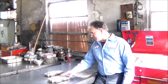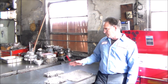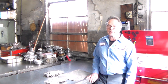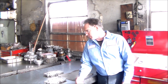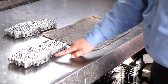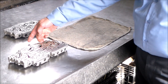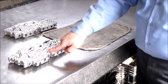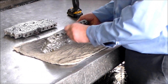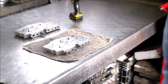I'll get a little closer and we're going to take this one apart, lay everything out, and then put it back into the new casting and install the lower front half onto the valve body. These are T27s, so I'm going to take the plate off here, the plate off here, and there's one back here with the accumulator valves, and then there's one in the center we've got to take off.